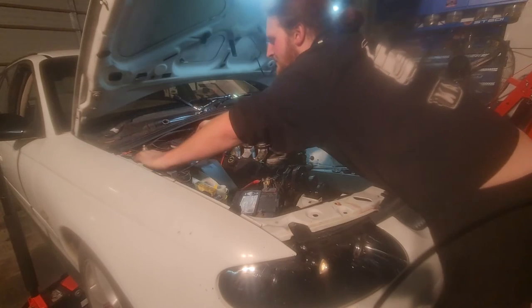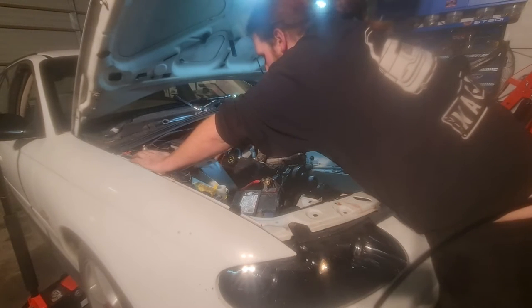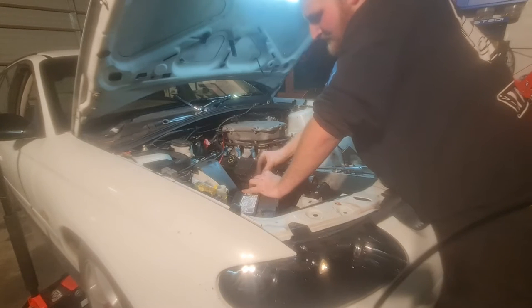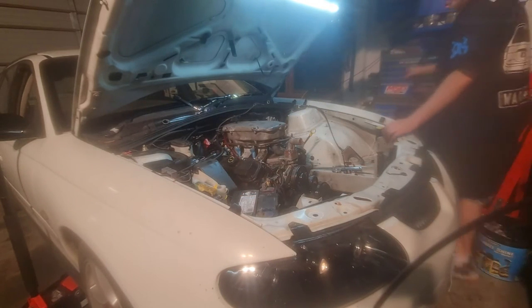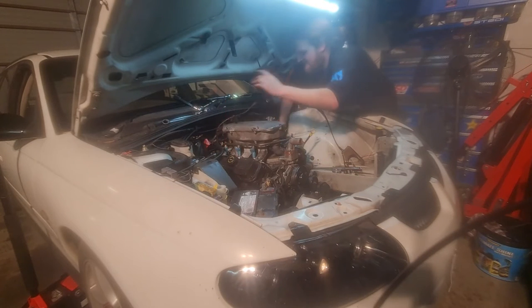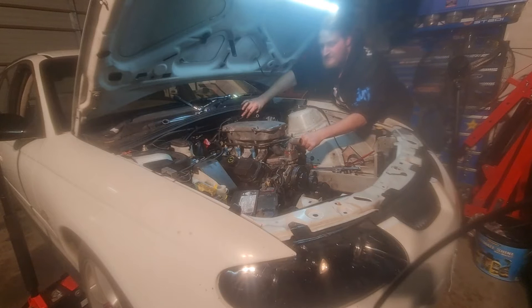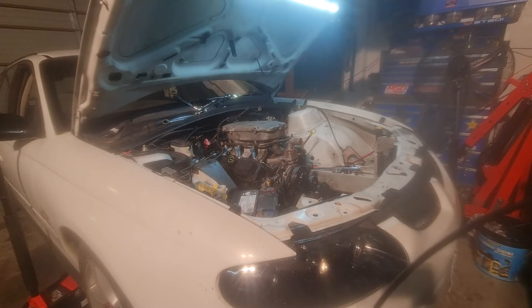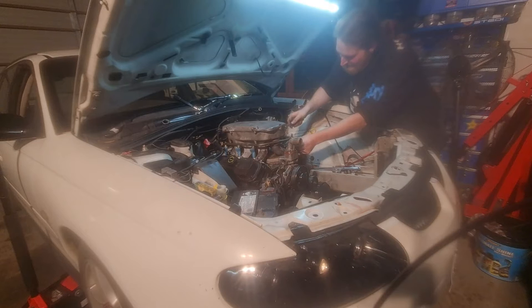Oh, wait on, hello. Yeah, a little fuel. Well, it smells fantastic. Remove this pesky amp wire out of the way. No sparky sparky, please. I shall remind myself later on to make sure that's actually tight. Now, these bolts are a 10mm, but a 10mm will not fit on them properly. They will strip, so 3/8 socket for that one. I would attempt to fit my electric ratchet in there, but some part of me knows that probably won't end well.